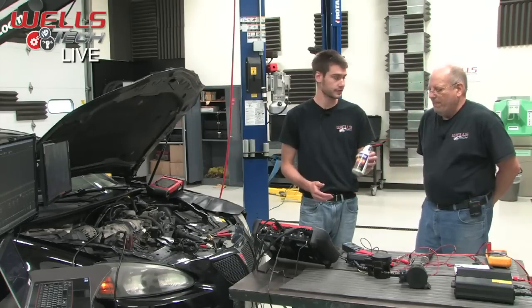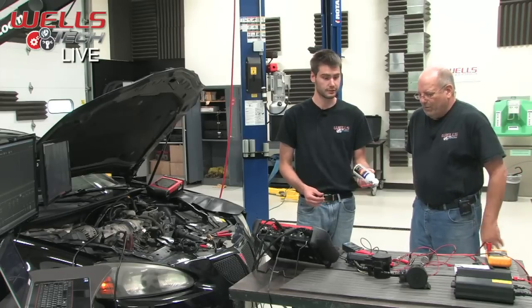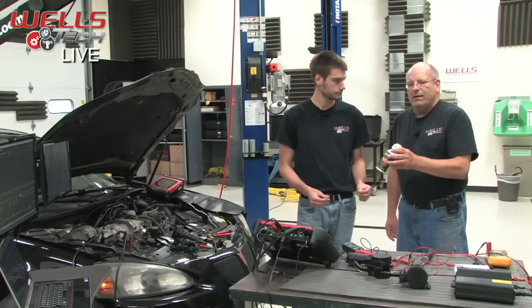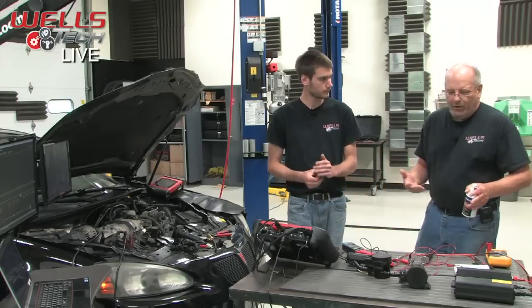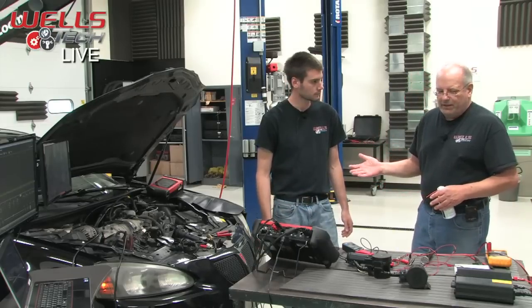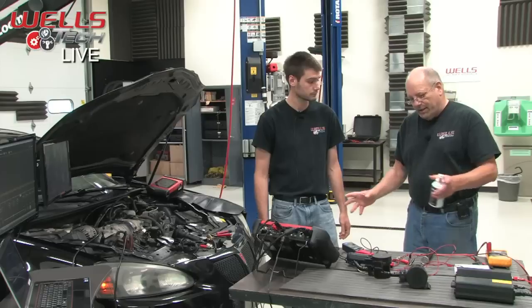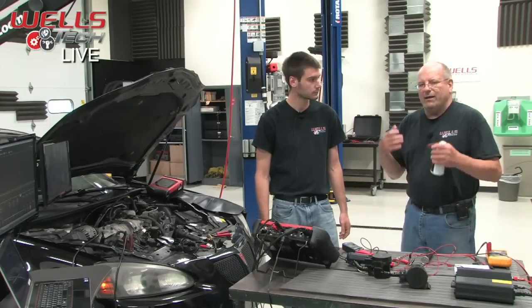We even tried freeze spray on there, trying to cool the thing down, it says it can go down to negative 62 degrees. The reason that we did that is because when we were going through our checking, at one point you had checked the resistance on it, and we were at 1.5 million ohms. We took the connectors off, reconnected it, and it read it again.